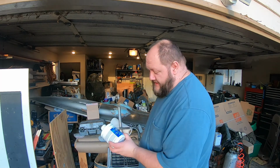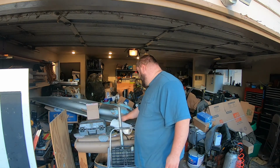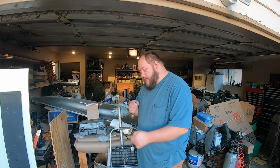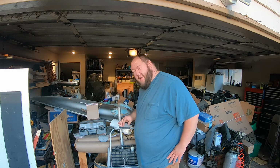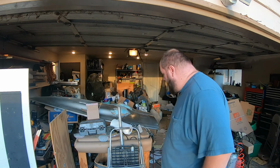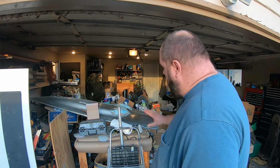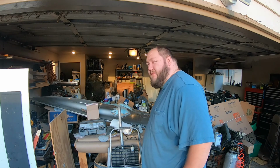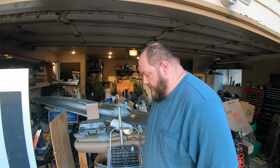This Polyflex is super quick. I like that. It was peeling off really easy off the spatulas, but it didn't really peel off easy off the panel. So, hit it with some 250, get those contours rounded over, and then get it over to the paint shop. And then once I get this painted and back, I'll go ahead and post the final video of me putting it on the side of the truck.